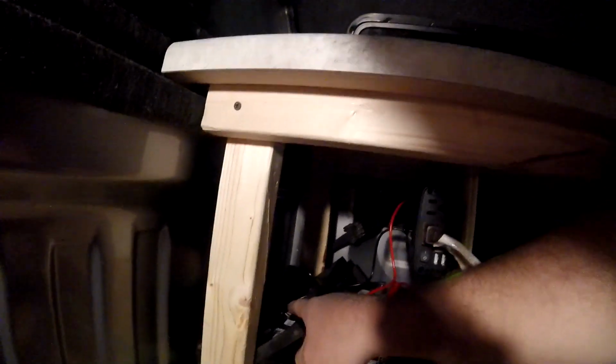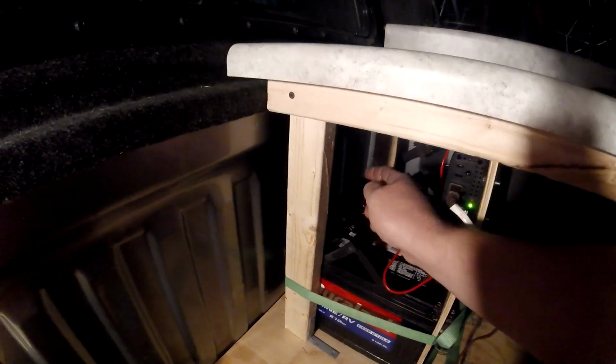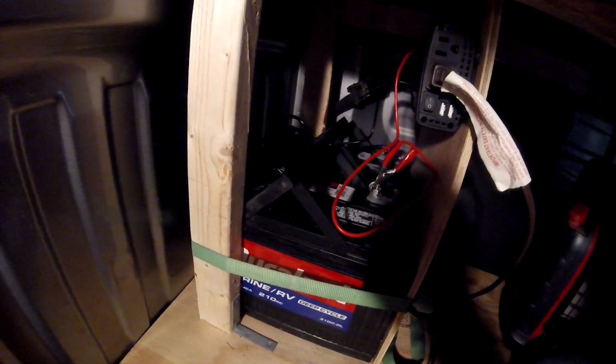It couldn't even make it to the ground side of the batteries the way I'm going to tape it. So you cannot let a cable that is coming directly off of a hot get anywhere near ground. See how I've got these cables on this side of the handle, and I've got those cables on that side of the handle, so that they cannot touch each other, because fuses won't work upstream of the fuse holder. They only work downstream of the fuse holder.